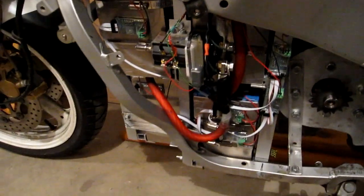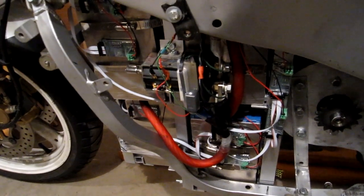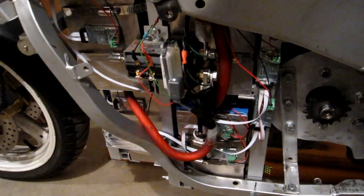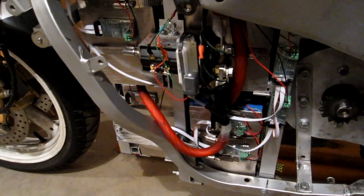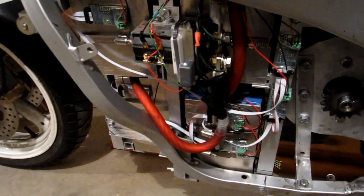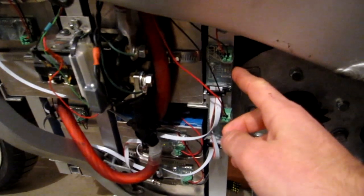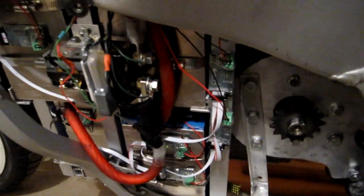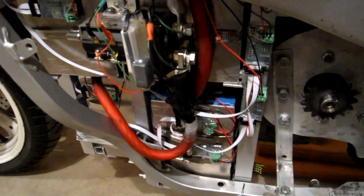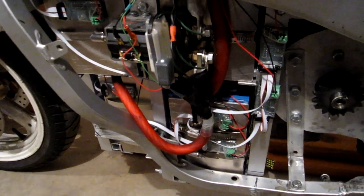There's a whole bunch of those remotes — 24 of them on here. And if you're really observant you'll see that they're blinking. Each one is heat shrunk in a clear heat shrink, so they're all electrically isolated from everything they're touching. The way they're mounted is with foam tape, so there's a bit of space between whatever they're touching and themselves, and then there's the heat shrink on top of that. So they're pretty well insulated — very small chance of them ever shorting out on anything.